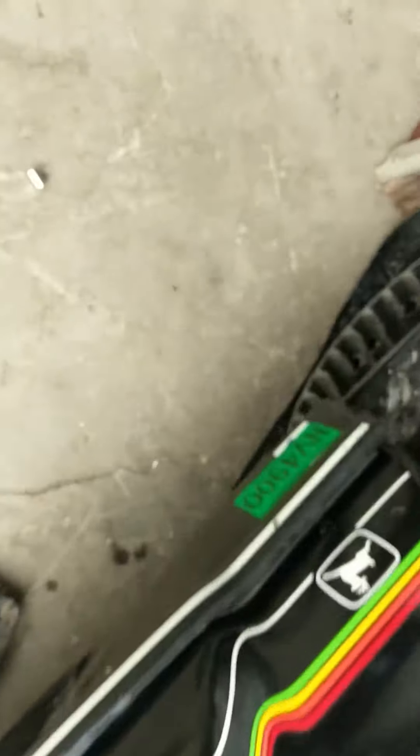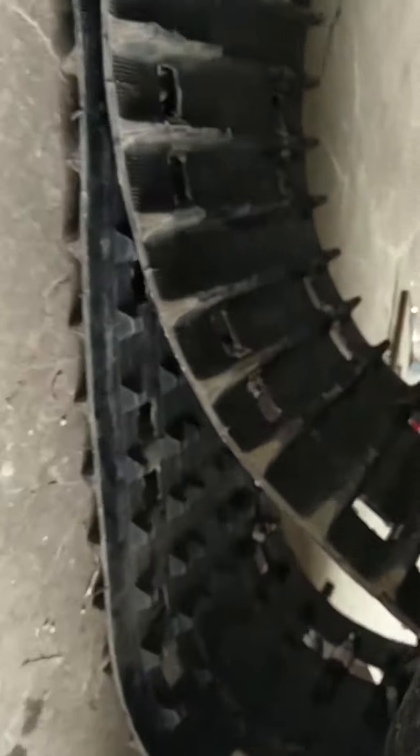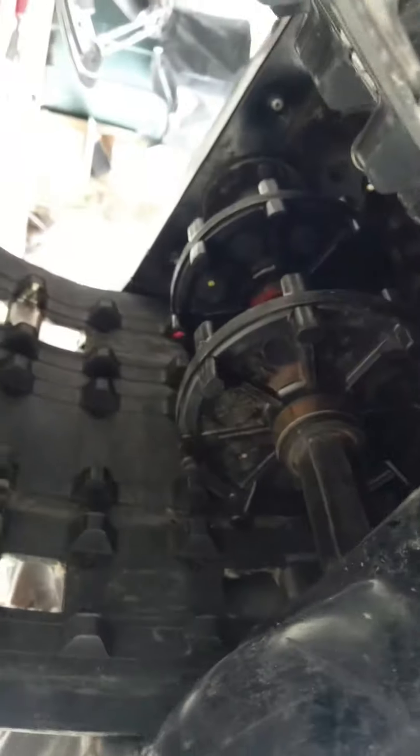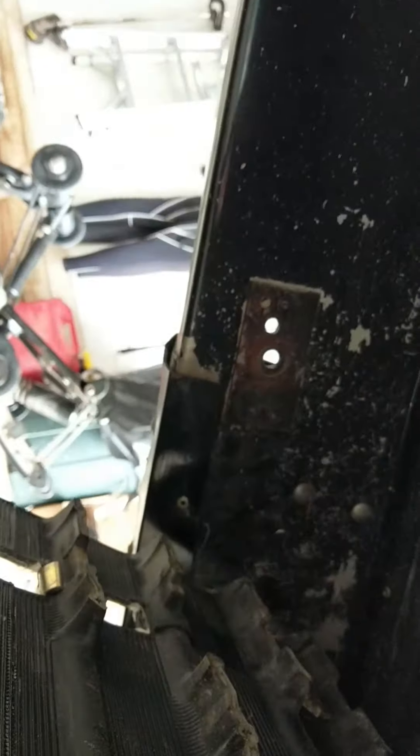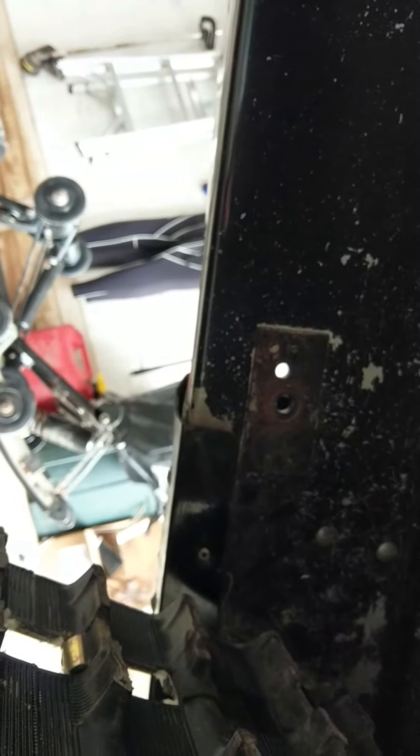The sun's bleaching out the video — let me get a better view from this angle. Drive shaft is installed up in there. I only went with two drivers. There's the first hole at twelve and a half back, four and three quarters down. The second hole is 23 inches back from the center of the first hole, center to center, and four and three quarters inches down.